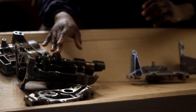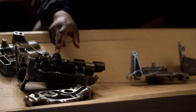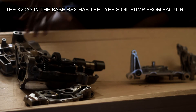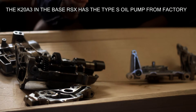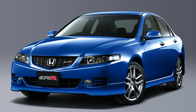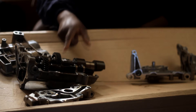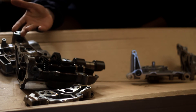A lot of other K20s have this setup. Strange enough, the K20Z3 out of the 8th gen Civic Si has this. I don't know if it's ported a bit differently, but all the K24s have this. Strange enough, all the European Type Rs — the UR, CL7, FN2, K20Z4, the EP3 Type R — have balance shafts, which is kind of weird. So it's like a personal preference situation.